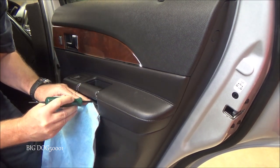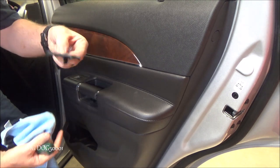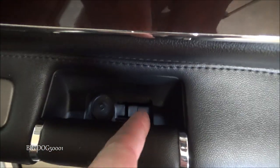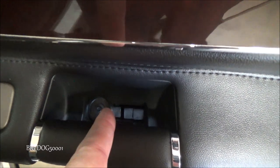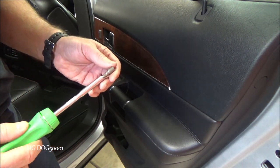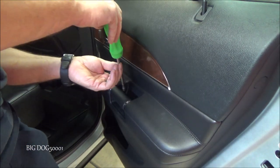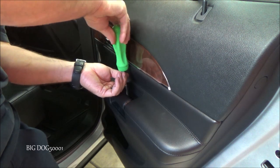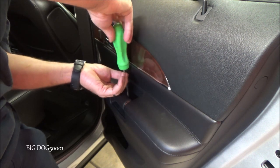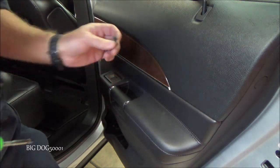I'll just take a rag and my little trim tool from SK, put it in there and pop it up. What's nice about this tool is because of the angle, it just pops it right up and out. You can see the cover out — it just clips right down in there. Now we've got to get that screw or bolt out. Sometimes they're a bolt, sometimes a Phillips screw. In this case it's a bolt and I'm going to use a 7/32nds socket — you can also use a 5.5 millimeter socket, they're close enough and both will work. It came out; sometimes you need a little magnetic head to grab it.